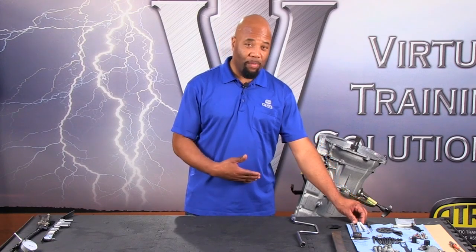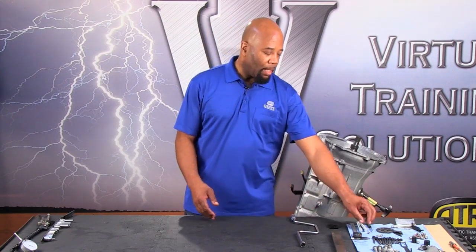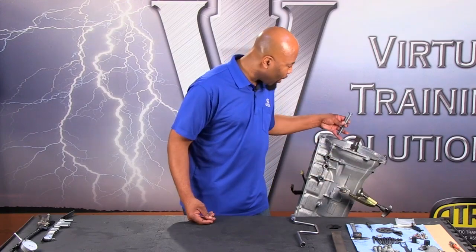It's a little bit rough. Basically there's a very thick O-ring that you have to overcome, and if this transmission has been in the vehicle for an extended period of time, it's not going to want to cooperate with you. We did find another method that is very useful and very helpful. With the threaded holes, we can actually pull the unit out with bolts — all you need is a couple of three-eighths by sixteen thread bolts.